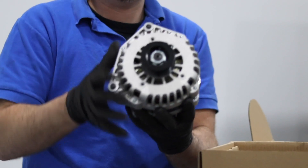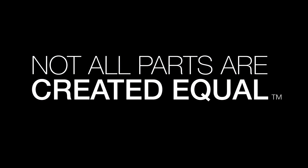In this video, we're going to be talking about fuel injectors and some different techniques on how to diagnose them. So your engine's running rough, you have a misfire, you probably have a check engine light flashing, and you've already diagnosed the fact that you have spark, your plug is good, your wire is good, and your coil is good.